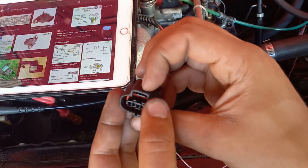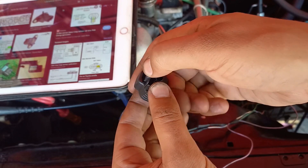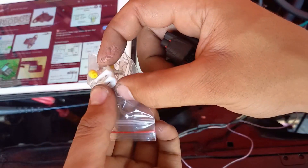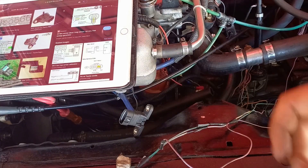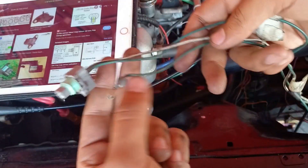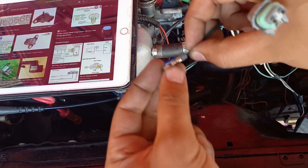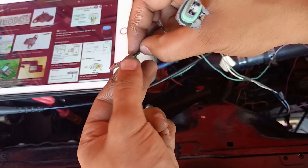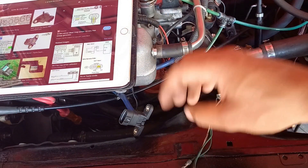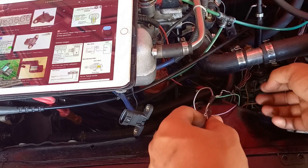These plugs look quite fine and sturdy — the plastic is rigid yet flexible, has a little clip on it, works quite well, and the pins look good. It even has the little Toyota pin lock. I'm going to crimp new wires onto my old setup. Previously I used two-pin plugs that I shaved off on one side, and this was my ground pin which I just pushed on the sensor. So we get rid of all that jankiness and now we're going to go with proper official wiring.